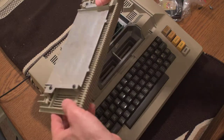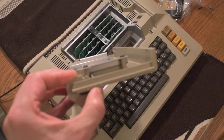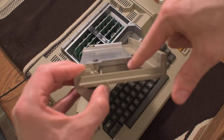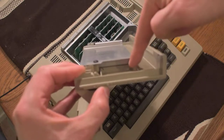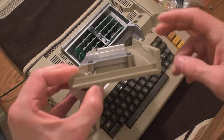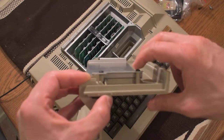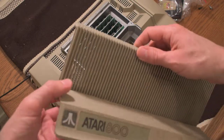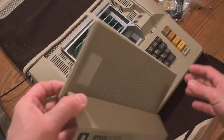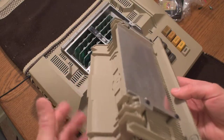My advice, see, I'll show you. These screws have a little plastic thing that they screw into, and that plastic can be brittle. You try to undo it, and it just snaps. But it depends on how yellowed the plastic is. If the plastic is not yellowed, it might be okay. I think the other one was stored in a hot garage or something. This one doesn't look nearly as bad, so those may come out just fine. But if you don't need to take it off, don't.